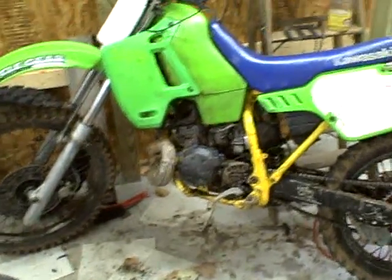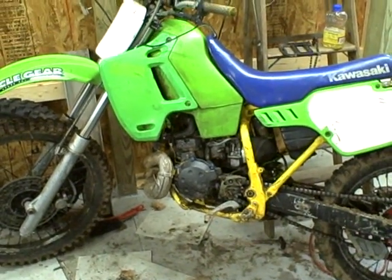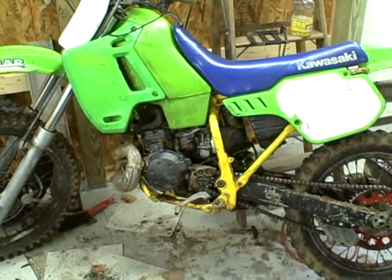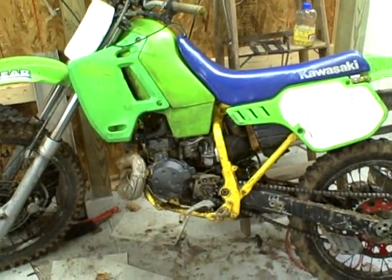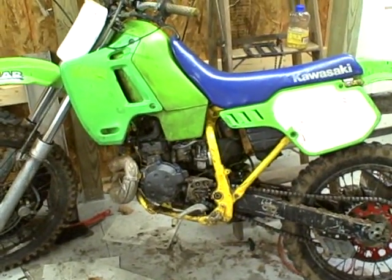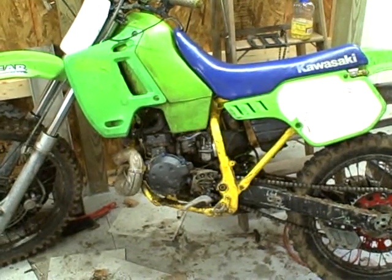The thing I really want to explain is something pretty different on this bike. In the 70s and 80s — maybe even the 60s — you could get a couple dirt bikes with oil injection. That meant your two-stroke oil went into a separate tank, and a pump would meter out oil by the RPM: hardly any oil at low speed, and more oil dumped in at high speed as temperature went up.